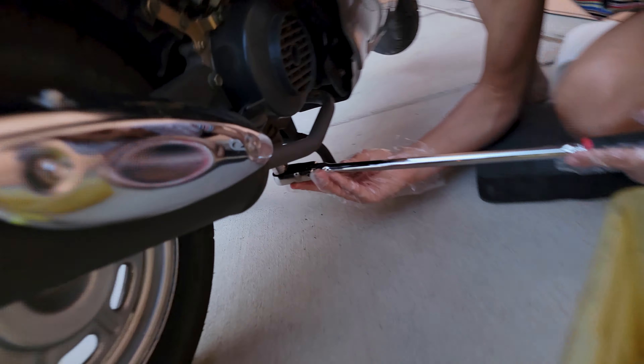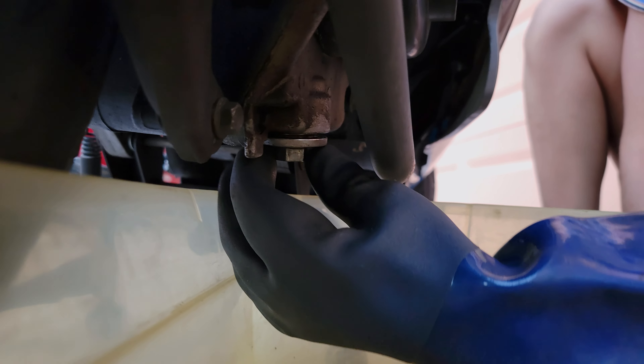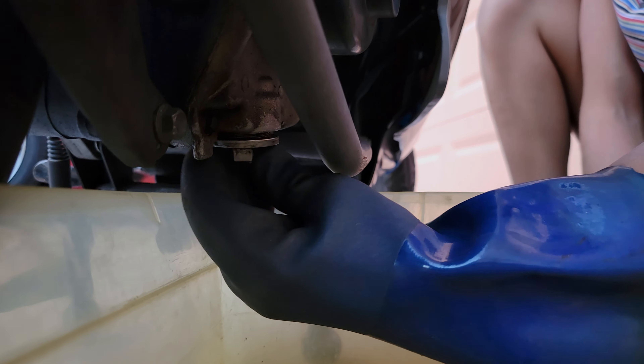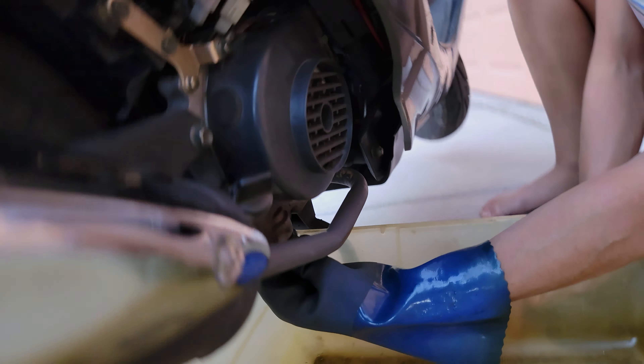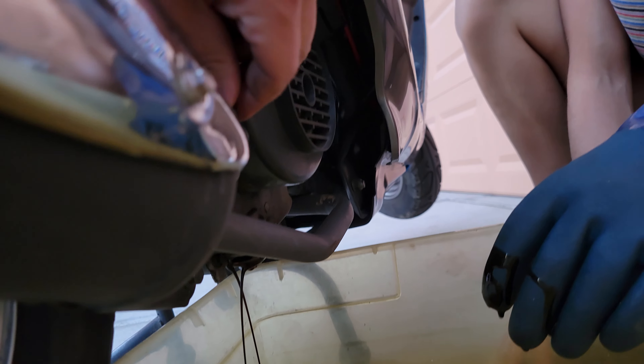We're turned off. It's time to drain. We got our 17mm bolt — that's our cute little drain plug and filter. Vanessa's going to crack it loose and get it finger-loose. He's got some good thick rubbers so it doesn't burn your hand. Keep going until all that oil comes out. I'm going to take off this plug so it drains even quicker.